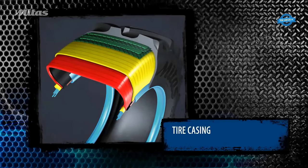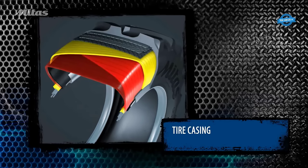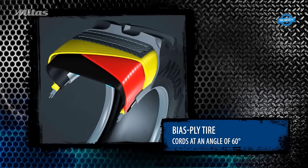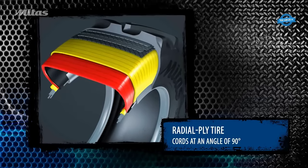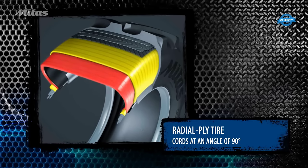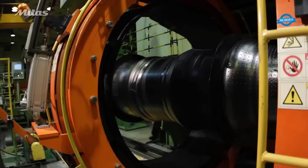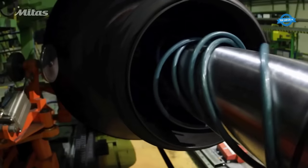The difference between radial and bias ply tires. There are two main types of tires: older bias ply tires and newer radial ply tires. In bias ply tires, the cord is laid at an angle of 60 degrees relative to the tire's movement, forming a crisscross pattern. In radial ply tires, the cord in the casing ply is laid at a right angle to the center of the tread. Radial ply tires are more complicated to produce but offer benefits such as fuel efficiency, longer lifespan, improved comfort, and reduced soil pressure in the case of agricultural tires.